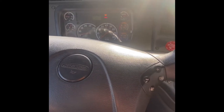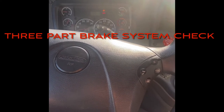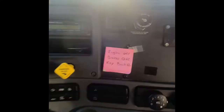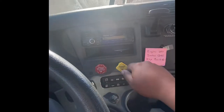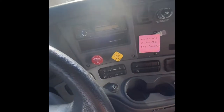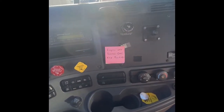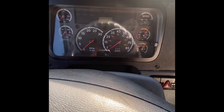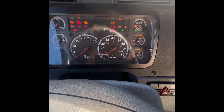Now that I've completed the in-cab inspection, I'm gonna start my three-part brake system check. The first thing I want to do is turn off the engine. Next, I release my brakes. Then I'm gonna turn the key back to the second switch position — here's the first one, and this is the second one — so all your gauges should turn on.